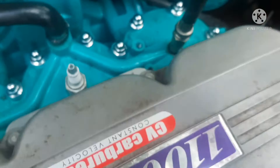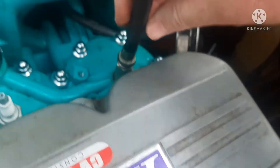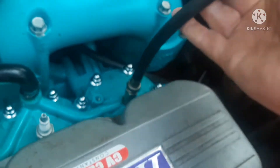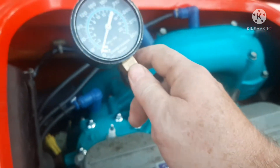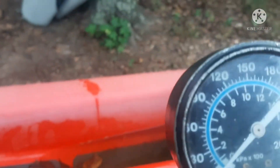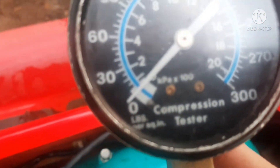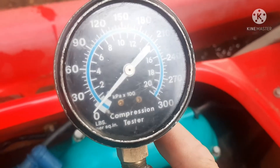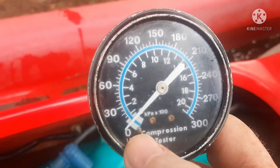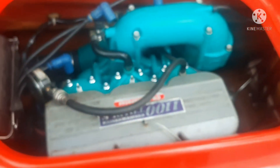I'm turning the compression gauge into it — you don't have to tighten this compression gauge up with a wrench or anything because it's got an O-ring at the bottom that's going to hold most of the pressure. My gauge is not all the way down; there's a rest stop on the gauge. It is in the zero range but not all the way against the pin. So maybe this isn't the most accurate gauge in the world. We're going to do a compression check on that cylinder.